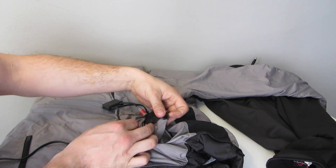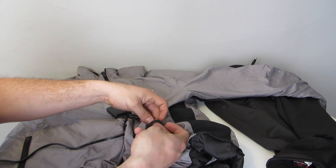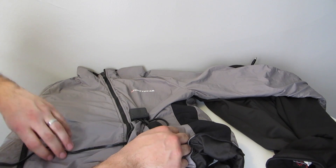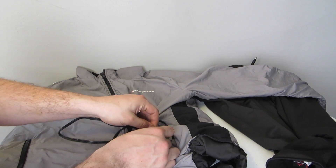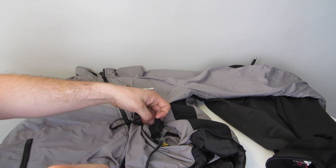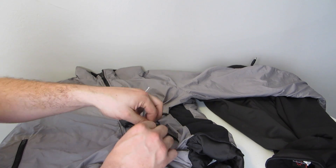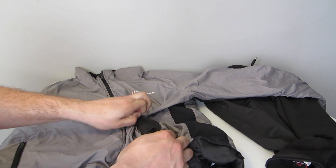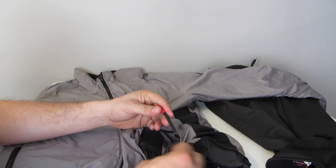The longer cord with the red tip is your power source — that's what you're going to plug into the bike. There are two holes in the bottom of the pouch. On the right side, looking at the jacket facing you, is a larger outlet where you feed your two heat zone cords through. Pull both of those through, then feed your power supply cord through the hole on the bottom left. Pull everything completely through, and your heat troller will slide right into the pouch, nice and snug, tucked away in your pocket.